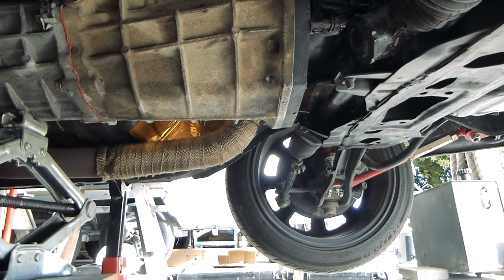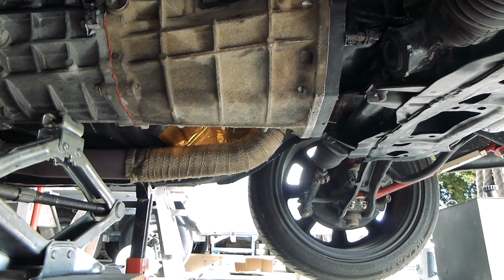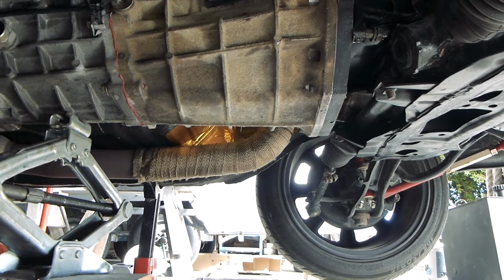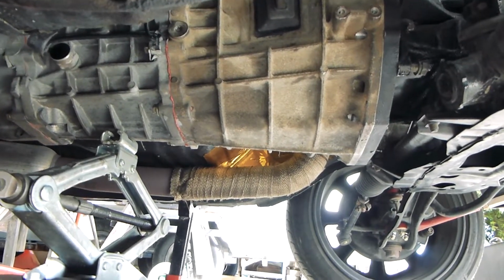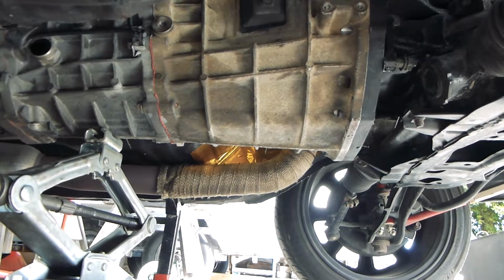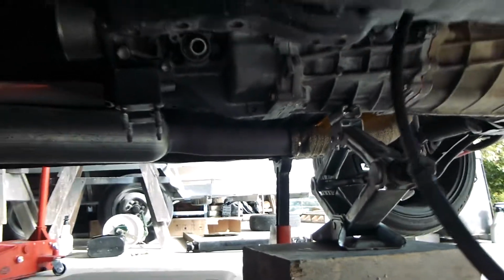But she's on now, clutch is on, and slid the gearbox on, and once that located in the clutch and then in the spigot bearing, dowels on the adapter plate lined up quite nicely, and whacked some bolts in and clamped it up. I've now got it resting on the jack to make a mount.